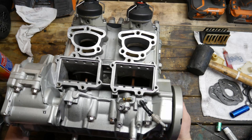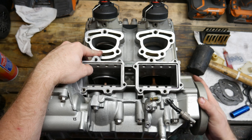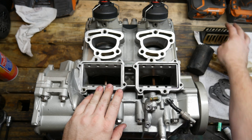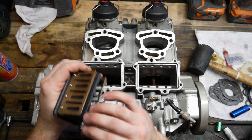Here's a great spot to kind of see how a two-stroke works. You can see the piston coming down and opening the exhaust port — that's basically your valve on a two-stroke. These reed valves are basically just one-way check valves that only let air in but won't let air go back out.